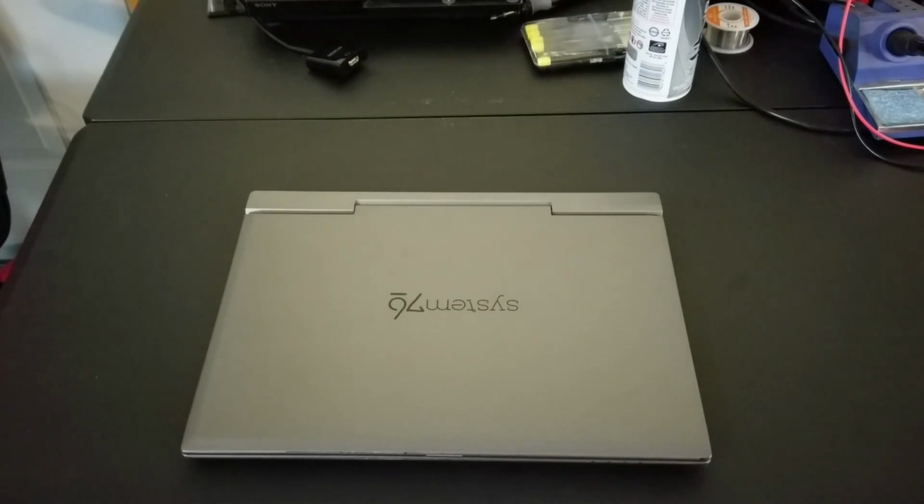The other thing you can look for is things that are easy to fix, like battery issues or charging problems and things like that. Now, not all of them are easy. Sometimes you get one and you think, I'll just replace the battery or whatnot, and it ends up being something major. But for the most part, if you look for something that can boot and that can run an OS, they have screenshots of that, then you're probably dealing with something where the hardware is okay, and you just need to focus on some of the simple fixes like replacing batteries, or replacing a RAM stick or a hard drive or those type of things.